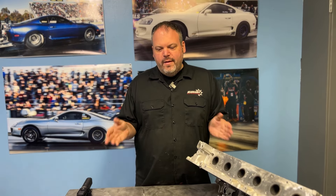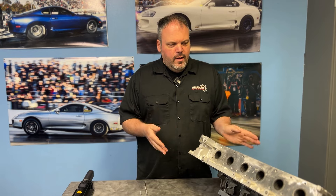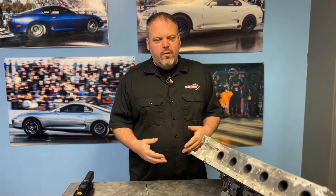Overall, I think the head came out pretty good considering it didn't have our spring kit anymore and Neanderthals worked on it and changed the valve job, killing flow — that is actually something we cannot fix. You can always take material out, you can't put it back in, and we're not going to put all new seats in this thing to save it. So what my man's going to do is we're going to refresh this thing and he's going to keep it as a spare. He's going to send us a brand new head so we can do all of our stuff to it and he has something reliable for years.